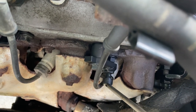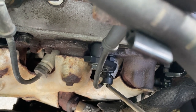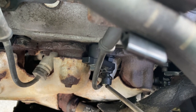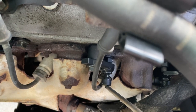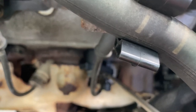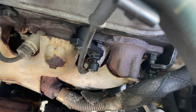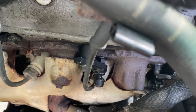The only unusual thing here: the cinch bolt is 8 millimeters. I used an 8mm allen/hex wrench, and they say to cinch it to about 15 pounds. I didn't have an 8mm socket for my torque wrench, so I just did it by hand and made sure it was relatively tight. This one was by far the easiest thing to put in — maybe 5 minutes, not even. I used a 15mm on the main bolt.